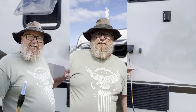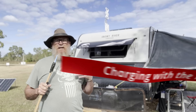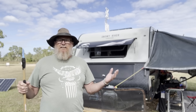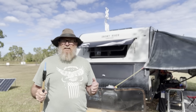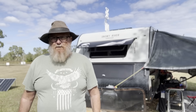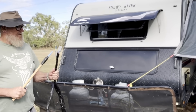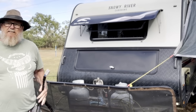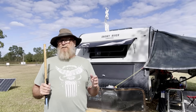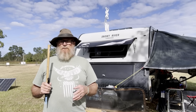You're probably thinking, what happens if there's no sun out there? What if you're out in the bush and it's been overcast for a week, then raining for another week — two weeks with totally no sun? How do you recharge? Well, what we've set our caravan up with is an MPPT DC-to-DC charger at 40 amps. We've hooked it up to the DC and run it through a plug, and we can plug that into the car. You've probably heard stories that you shouldn't have your car idling — we run a diesel, it's not good for it, this and that.